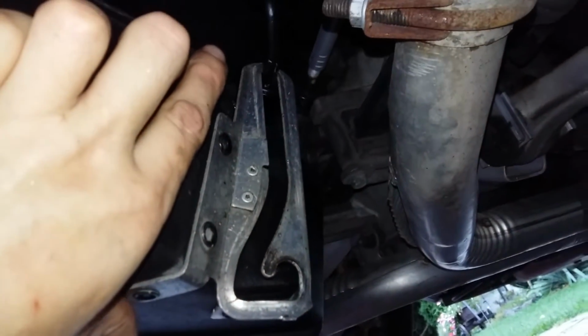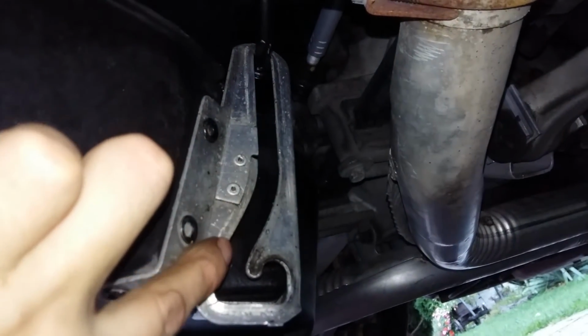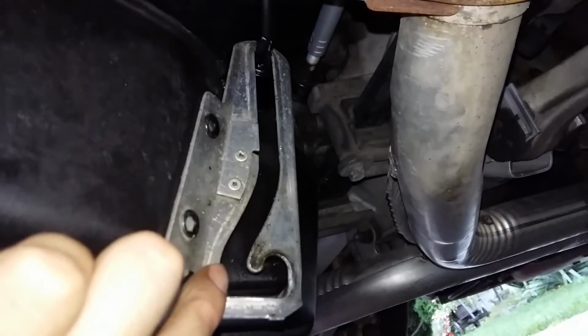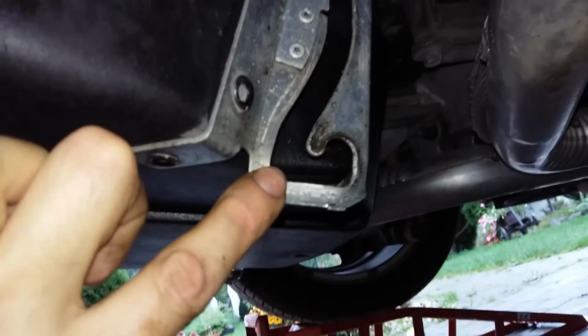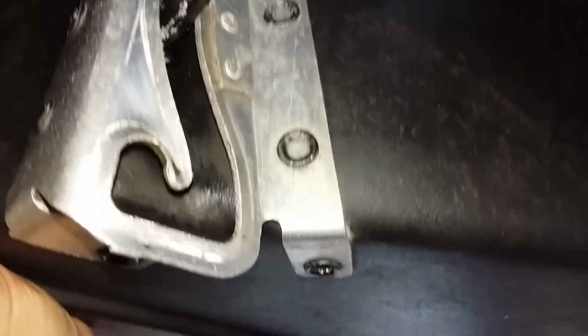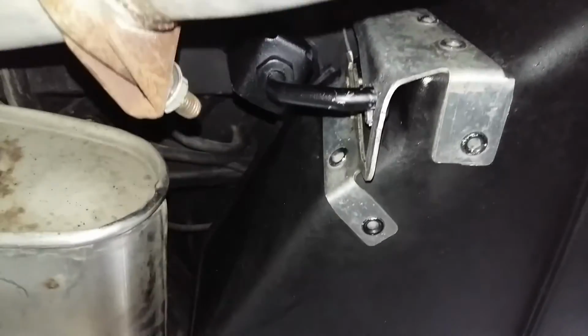Before I tighten the bolt back in place completely, I have to push the carrier up to lock the bracket hooks into the lower position of the aluminum carrier brackets. If I would not do this, the carrier would be too low on the ground and could be hit or damaged. Okay, so now we are where we need to be. One side and on the other side.